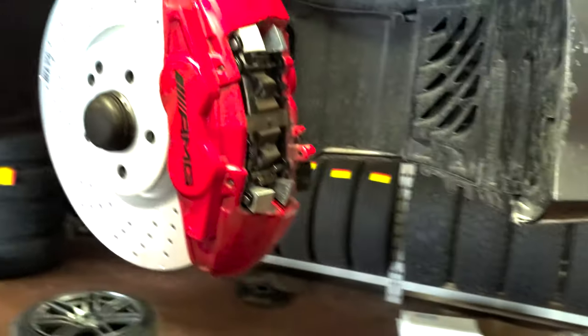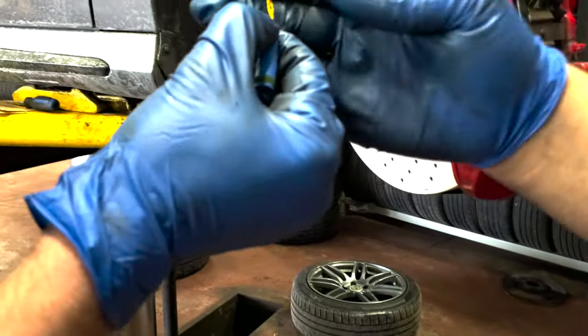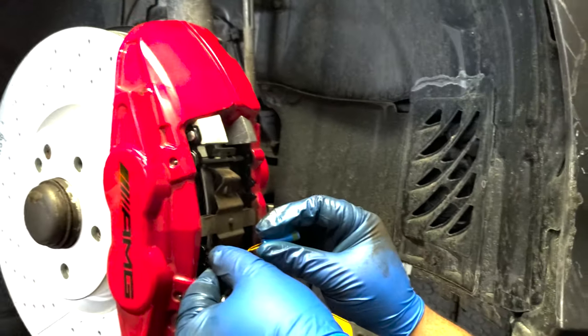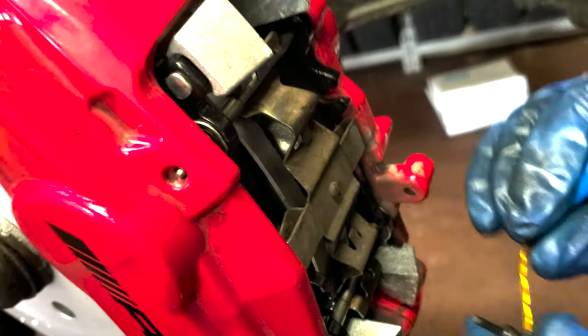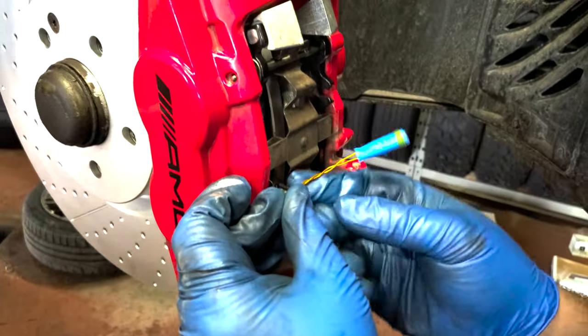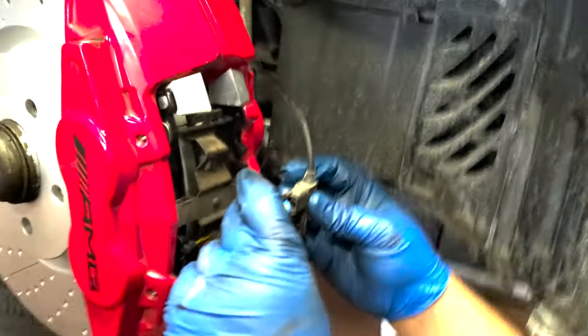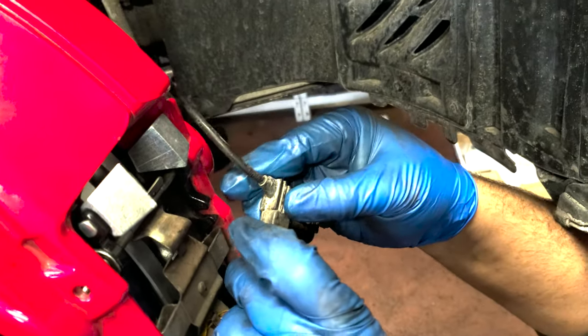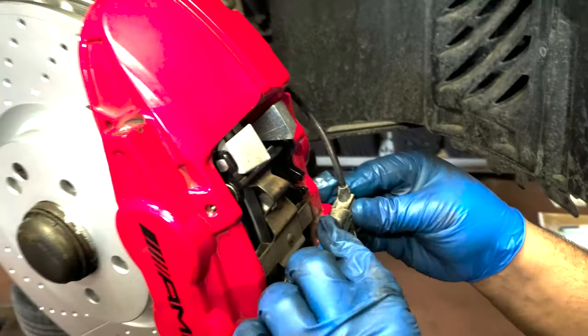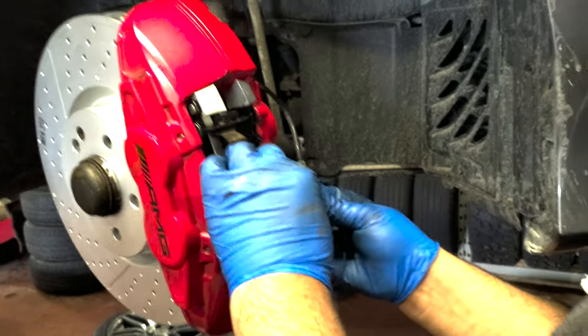Oh yeah, true, totally forgot about that. Which hole did I set it? It's on this one, right? Yeah. Then you put the new sensor in. It goes only one way and slides right into the pad. Goes just one way, and then you slide it. There you go. So new sensor's in. It slides right in, connect the connector, and put the bolt back in, and that's it.